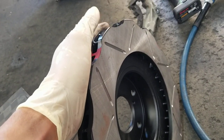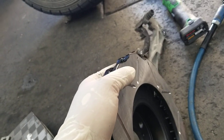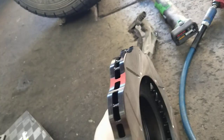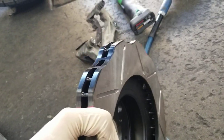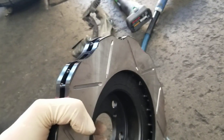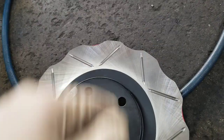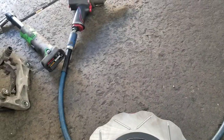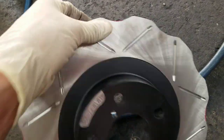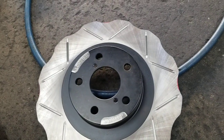The advantages I've noticed are that with the little chamfers cut in here, at the threshold of braking I actually have more modulation and control right before lockup. The brake temperature recovers more quickly, and in off-road environments I'm noticing it flings the dirt and mud off of the rotors, keeping it from getting caught. And the pad life has actually increased.